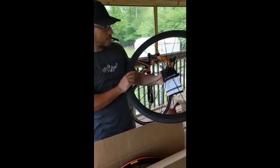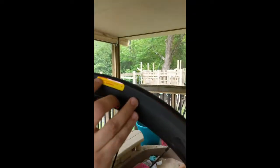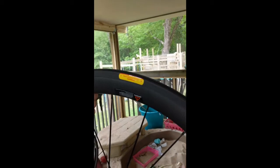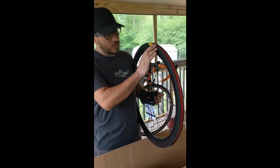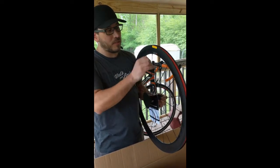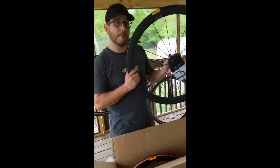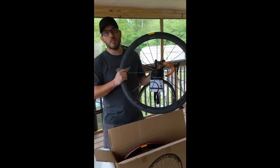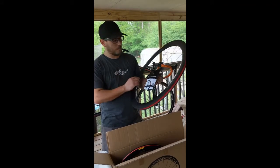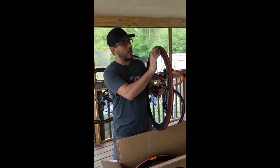The front looks pretty good. We'll definitely want to set a little warning here: put the brake pads a little below the edge. If you put them too high, you can cause rubbing on your tire, or if it gets too hot the tire can start swelling out. Some reviews mentioned wheels getting hot, but most people said they likely didn't have their brakes set at the right spot on the rim. You definitely want to set the brake pads as low as you can on the rim.